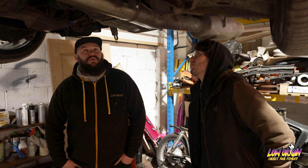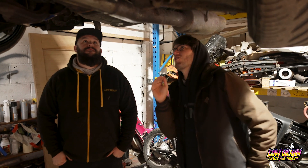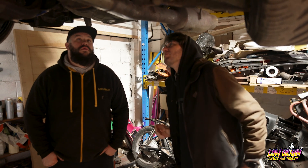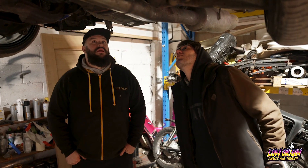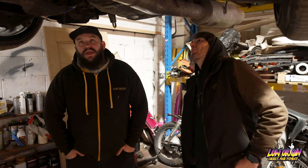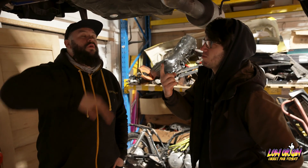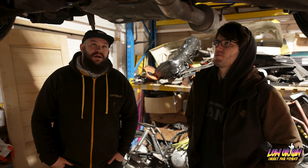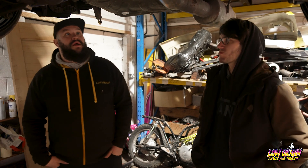So you're going to blow the diff up anytime soon. They came with the diff. The thing is people aren't mad keen on solid subframe bushes for diffs, because people like to give the diff a little bit of motion. They came with it and they look kind of cool so I'll put them on — but they'll probably blow your diff up. Is it two way? Two way now. Was originally a VLSD that was shimmed — that was a good shim — and it had a Skyline 4.1 crown and pinion in it. It was a great diff, never had a problem. I'm changing it for a two way, not sure if I'm going to like it.